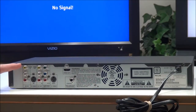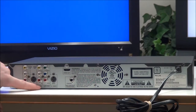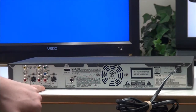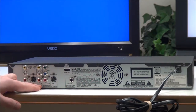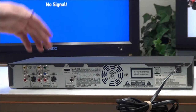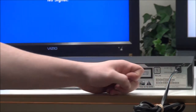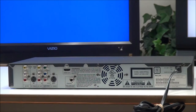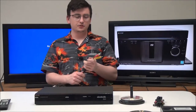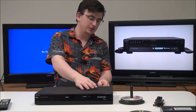On the rear panel you have your video input for recording and S-Video for recording as well, then composite video output and audio output for standard playback, component output which is a little bit better than composite, S-Video, and HDMI which will be your best option, plus coaxial digital audio. This was manufactured in March of 2007, made in China, model number DVD-R3475. To connect it you'll probably want to use HDMI, but you can also use the red, white, and yellow hookup via the video output.